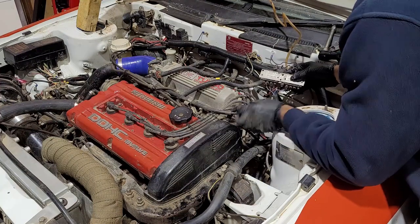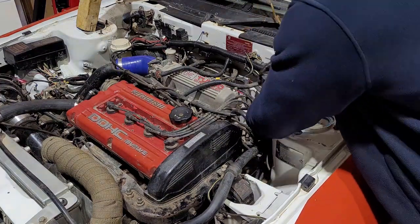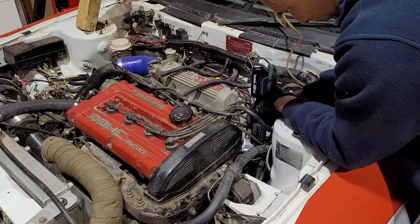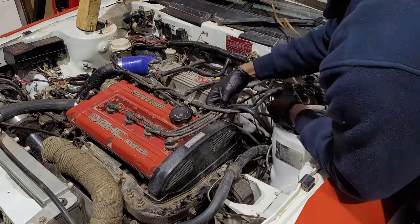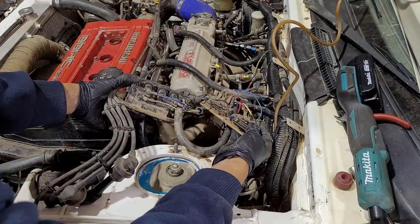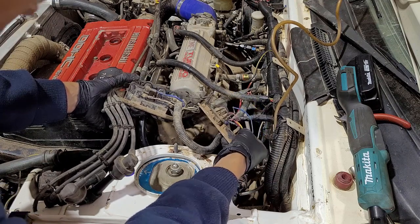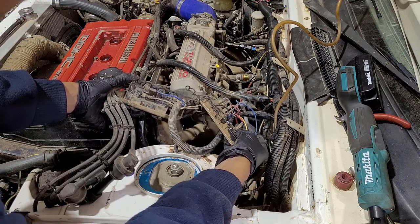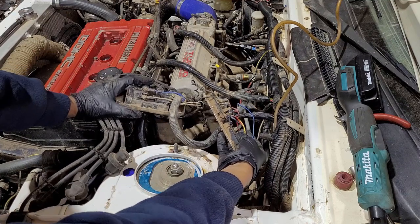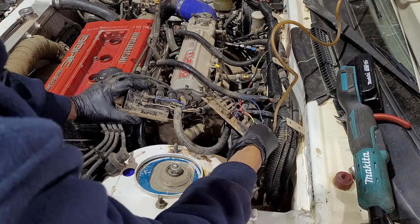The first thing we're going to do is start with the coil-on-plug conversion. I have said in a previous episode that I wasn't that impressed with this wiring setup, particularly because as you can see it's covered in mud and it's had water in there. It's not ideal, particularly for an ignition setup — anything that can get water in it with electrics is never a great thing, and this is something we need to sort out.